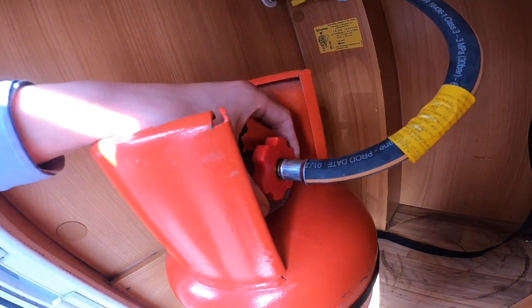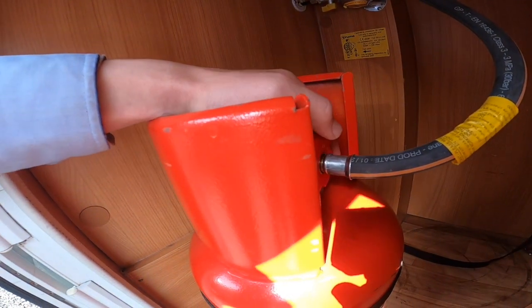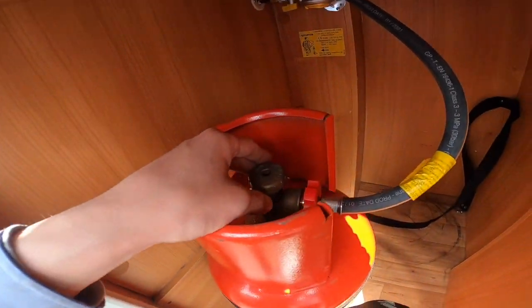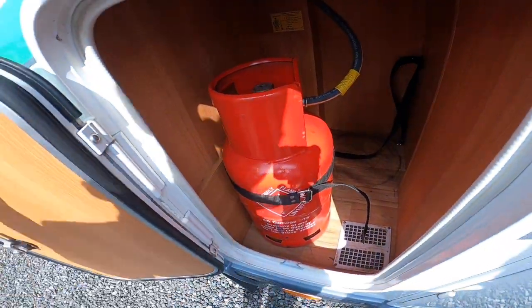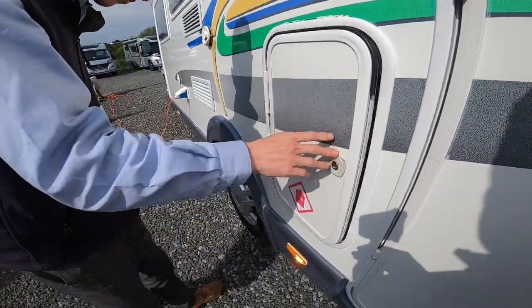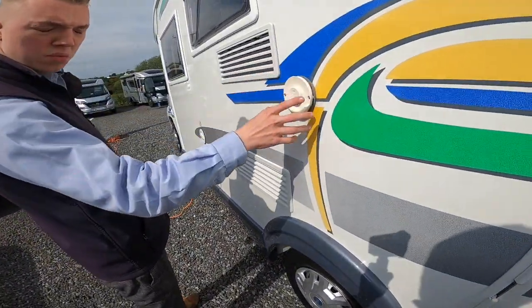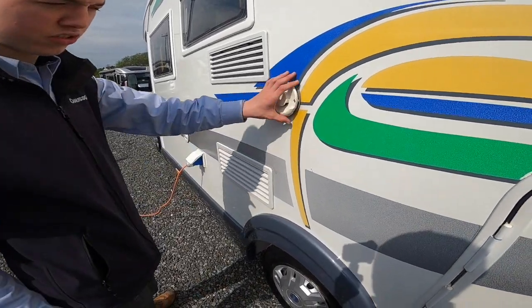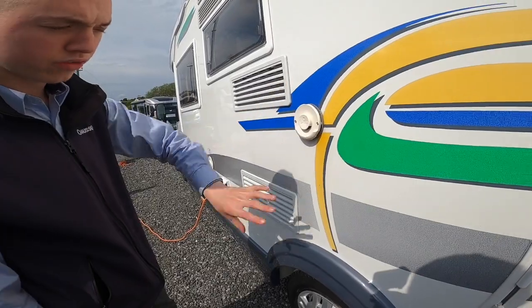Your pigtail is just a hand-tighten — it's a left-hand thread to tighten, as gas fittings use opposite threads. Turn on and off at the top of the bottle. This runs off a six-kilogram propane bottle — propane, not butane. You've got your Truma vent for your boiler, so make sure that's not obstructed; it allows fumes out when heating the water or the vehicle on gas.